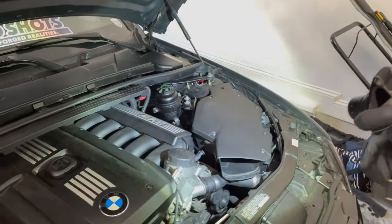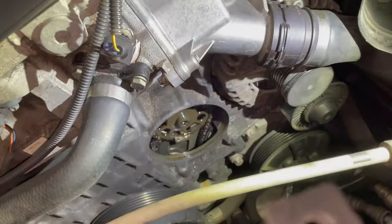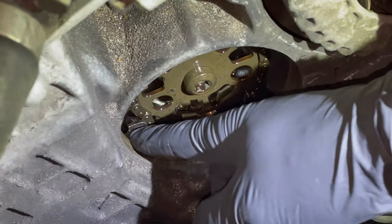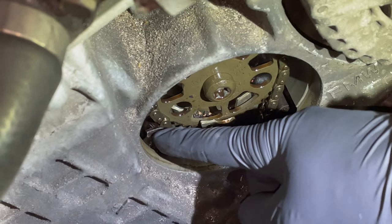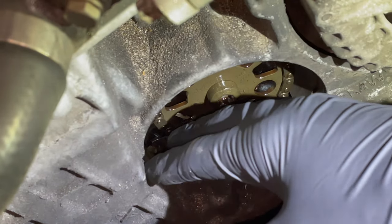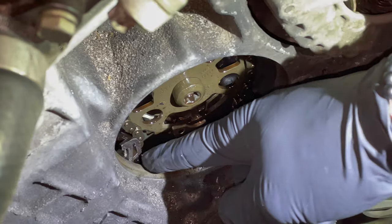This is like an extreme rare case — N52, N51, whatever. We don't know why it happened. When we got the cap off, we noticed over on the left side this chain guide — on this specific chain circuit, this chain guide also has these spring steel liners on the back of it, so this is also the tensioner. As you can see, it's offset and pinching the chain, and I can move it really, really easily. That guide is snapped in half. This is the true problem the whole time. The symptom was that the vacuum pump was not operating right, which made it look like the vacuum pump was faulty. But in reality it's actually the chain setup that is messed up due to the guide and tensioner being broken.